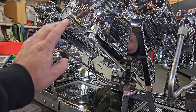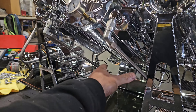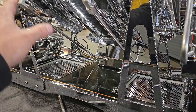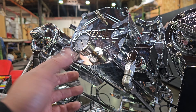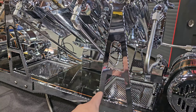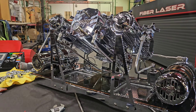Tubing's all done. We're gonna have to send these out for chrome. There's a little wiggle here so we're gonna build a bracket. I already have a riser bracket to get that angle, but we're gonna build another bracket to support this. Ideally I'd love to go in here but this is already chrome. I could always just drill and tap into this backing plate — it'll only take small bolts. I'd like to have something that matches this. So next step is to get this bracket all built up and head to the computer to get that programmed.